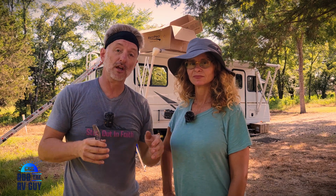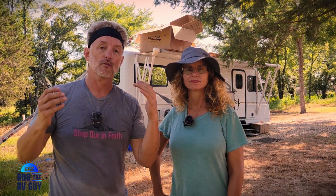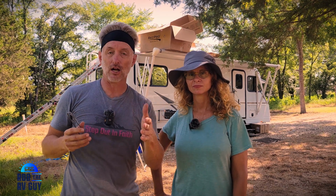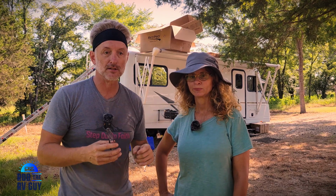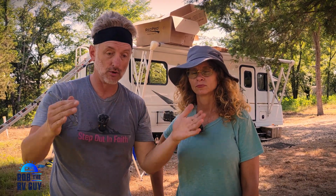Well, that's going to do it for this week's episode of Bigfoot Friday, the install of the Houghton from Rec Pro 13,500 BTU air conditioner on our Bigfoot 25RQ. A couple of closing thoughts on this. The installation was simple on the Bigfoot. The space is perfect. This is meant to go over a 14 by 14 or 14 and a quarter square opening where your standard vent fans would go.